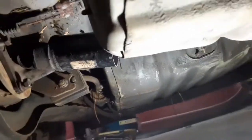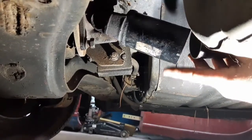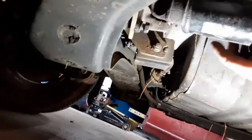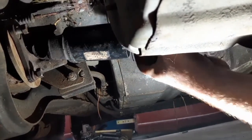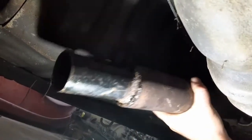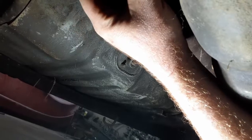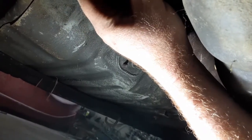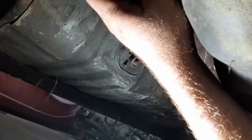Alright, so I'm going to lift up the other half of the driveshaft and see where we're at. So holding this end up there, we've got about a half inch gap. I'm going to bottom out this end of the driveshaft up into the transmission again, pull it out about three-quarters of an inch or so. Check it again and I've got about another half inch gap. So I cut my shaft about a half inch too short, so I'm going to have to leave about a half inch space when I weld this back together. But it'll still give me a good mock-up that I can use.